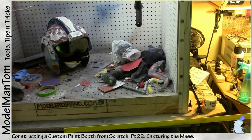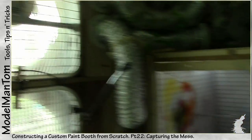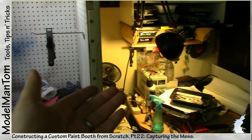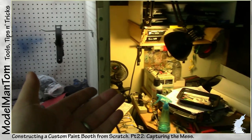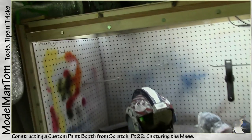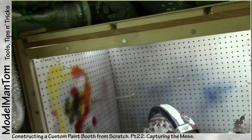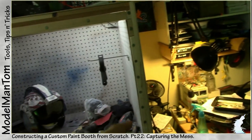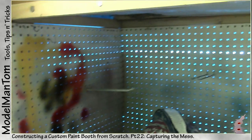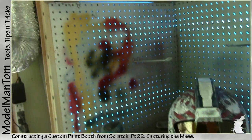One upgrade that I should do, but I don't know if I will, is you can see the difference in white balance here. It's daylight outside, so these LEDs match that. However, at night, the white balance doesn't match, and I'm kind of screwed in that regard. So the alternative I have is, under here you can see that there are strips of LEDs going on. I'll run parallel strips in warm white so that I can flip the switch, because right now I've got two banks of lights, one going to moody blue, and that one is not all that useful. It's moody, it's nice.